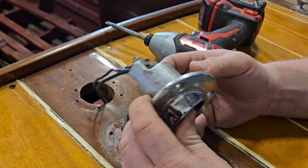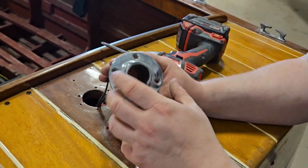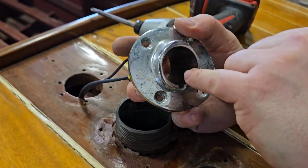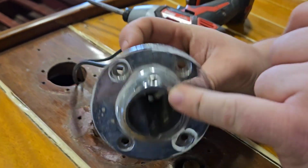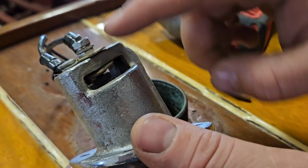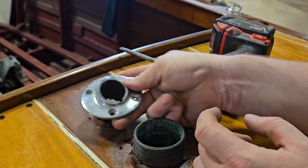So this is pretty cool how this works. This is the rear light post. I'm sure you saw me pull that out earlier. So how it works is you have your ground and then your power. So it'll ground out the case of this piece here. So this will be where your ground sits. And then way down in the bottom, I don't know if you can get that on the camera there. That piece right at the end, that'll be the positive terminal. So you'll have the isolated positive terminal coming through, and that supplies power to that little light post.